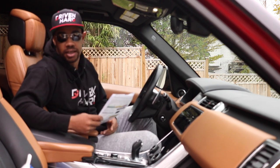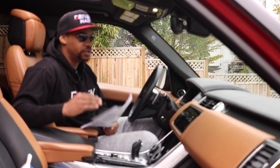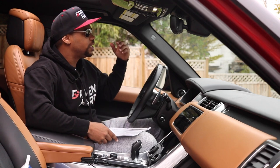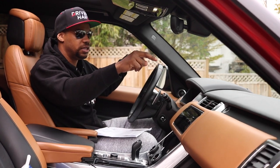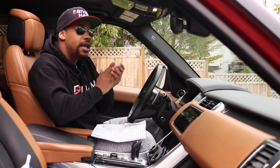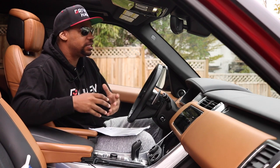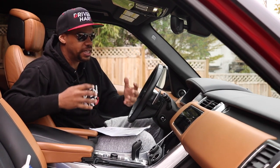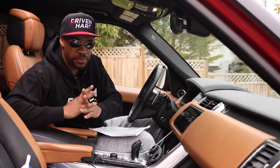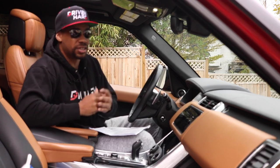The max wading depth for Range Rovers is 900 millimeters. I believe that's the highest of any stock vehicle right off the showroom floor. One of the reasons is because they have the air intakes at the very top of the engine. The second thing that prevents the wading depth from going any higher than 900 millimeters is the electrical components, including in this case the starter motor. The starter motor is placed low enough to help reduce the amount of heat, and I believe it's connected to the flywheel to turn the engine. That point does affect the wading depth because it can get wet but cannot really be submerged.